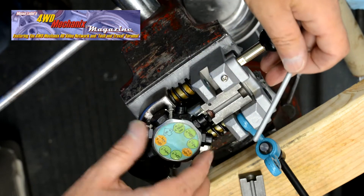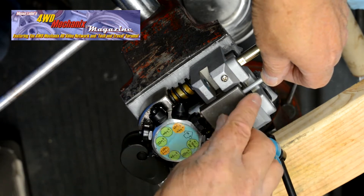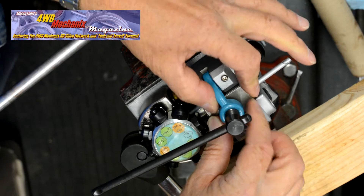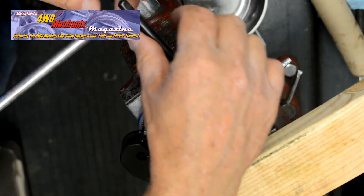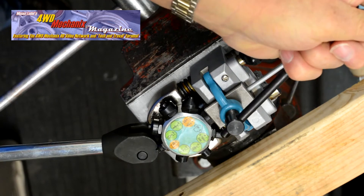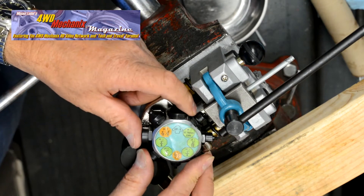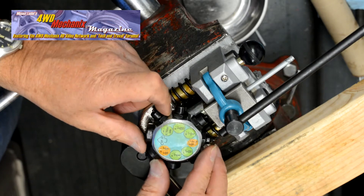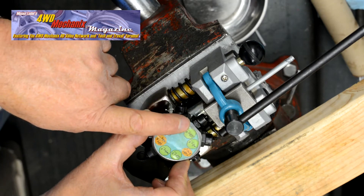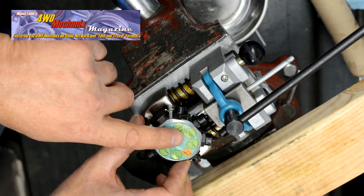This is zinc coated OEM replacement steel brake tubing. The half dies are once again 45 degree inverted flare type. Tighten the bridge screw just enough to secure the die block and allow the tube to slide freely through the die halves. Square off the blocks and the tube end with the flat punch. Tighten the bridge handle. The first forming step is the bubble flare. This is a punch for the 3/16 inch diameter tubing. Lube the tube end with red rubber grease, which is harmless to rubber or brake parts. The use of this lubricant will help the tube end slide into the punch form better.